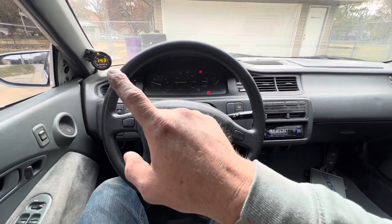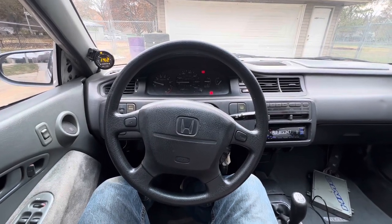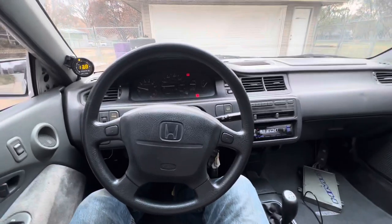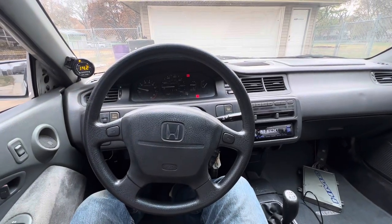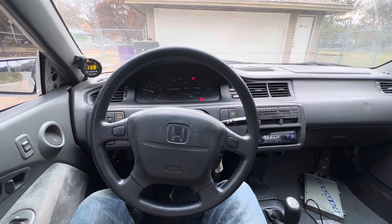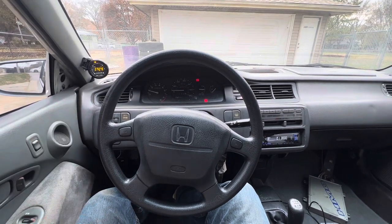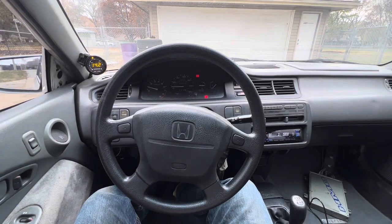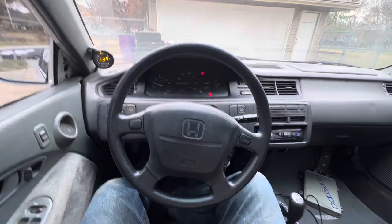So yeah, that's a pretty good place to be as far as idle. It seems like it jumps around a lot, and that could be injector data or something. Like I said, these injectors are pretty inconsistent. So ideally I would like to only see it jump, I won't even say a point, like 0.2 or 0.3, not 0.5, maybe it looks more even than that. So we'll say 13.5 to 14.5. So a solid point that thing jumps around at idle, which I'm not a huge fan of.